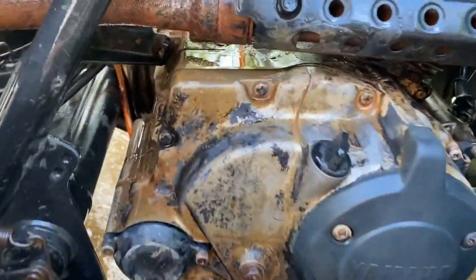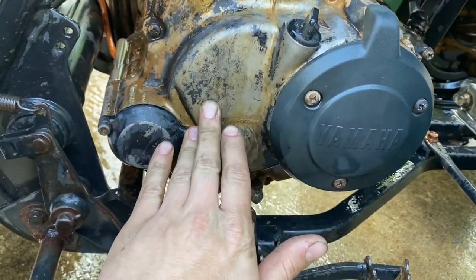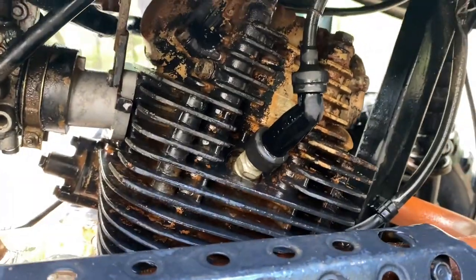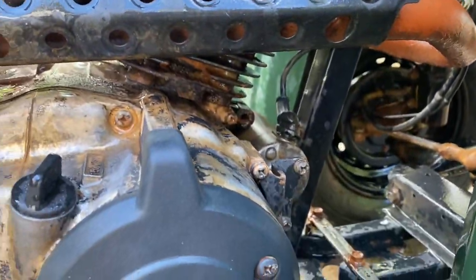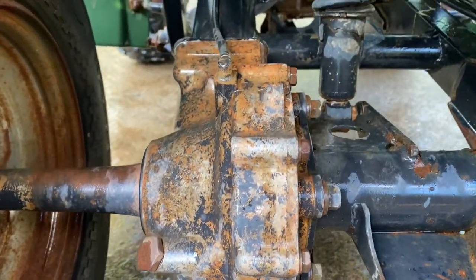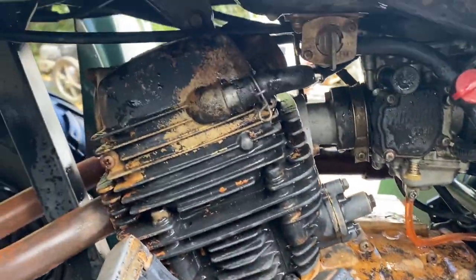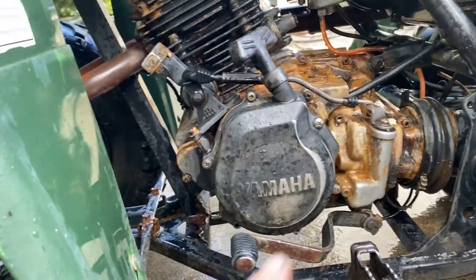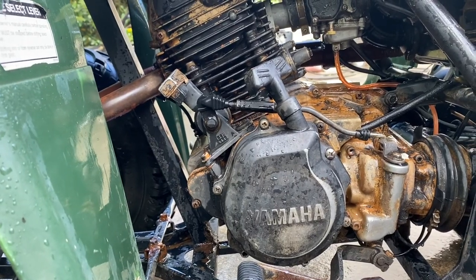I think that gives us our answer. The side with the paint stripper took most of it off — I didn't even let it set for the full 30 minutes. With brake cleaner we got some stuff off, but not quite everything. The paint stripper did a lot — this side was completely black. The brake cleaner side was already kind of coming off and it did take a good bit, but obviously this would be a long process. It's not something I feel like doing right now because I'm not going to get it perfect anyway.